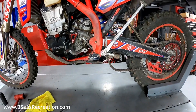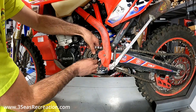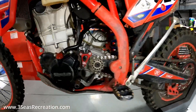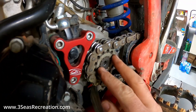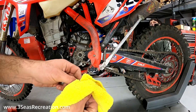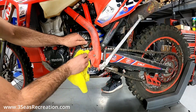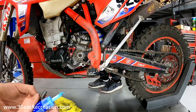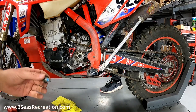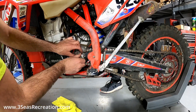Now we're going to take our sprocket and reinstall it on the chain. I want to make sure it is flush — that the spacer isn't pushing out on it — and mine is perfectly flush like we want. On the four-strokes we have to put the bolt back in; on a two-stroke you just have the circlip. I'm just cleaning up the spacer and sprocket a little bit and we're going to throw some blue Loctite on the bolt. Beta wants this torqued to 44 foot-pounds, so on the four-stroke only we'll torque this down, and that'll pretty much wrap it up.